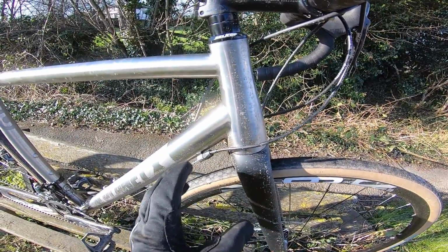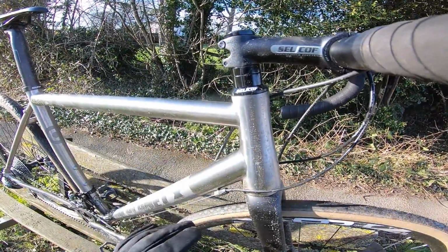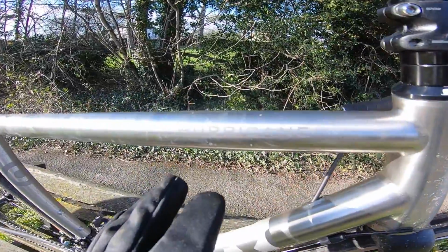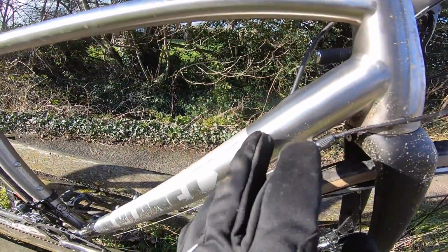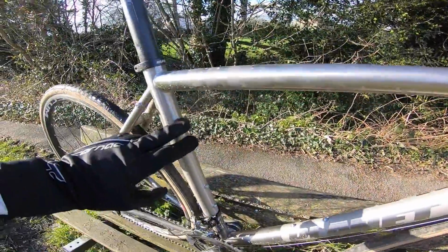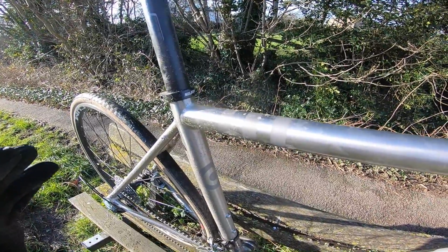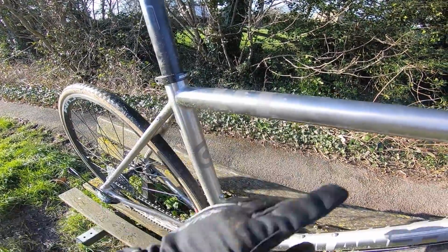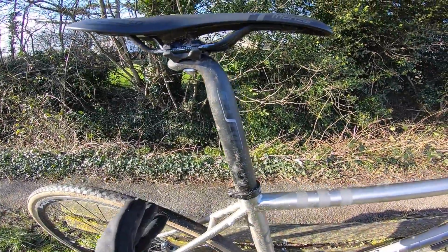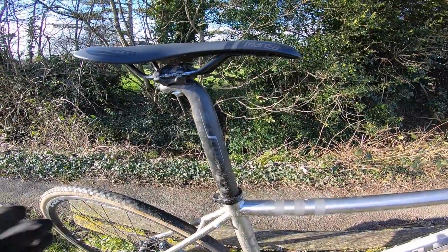It's not an external bearing, even though it's a tapered fork. It does mean you don't get a head badge, but it is a really sleek looking bike there. I mean, detailing is laser etched. You can just make out the Hurricane name there, and then you've got this Planet X polished panel. So really durable, really stylish, kind of subtle way of putting the logos on there. And because it's part of the Tempest and Spitfire sort of World War II fighter series, you're getting these invasion rings. It's a relatively large diameter seat post, 31.6, and so it's surprising it rides as smoothly as it does.